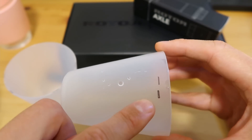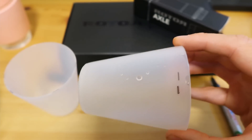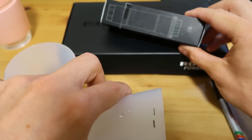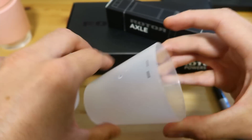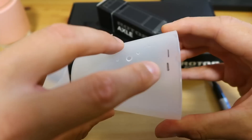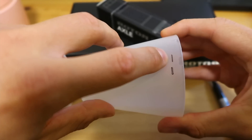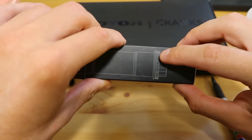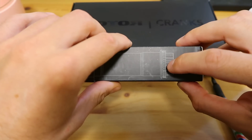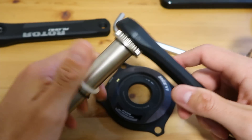You can clearly see the slightly bigger male taper didn't go in as far as the slightly smaller male taper. The tolerance of that diameter has to be so well controlled, especially with these tapered splines, because these aren't straight conical tapers you can turn accurately on a lathe — this has to be CNC'd with quite a complex cutter. The tolerance of that diameter and that profile has to be perfect, otherwise you get huge discrepancy. I measure about two and a half, nearly three millimetres of final axial position difference. If you had that on your spline, you either wouldn't compress your chain ring spider — so it would be wobbling around — or if the male taper was too small you'd compress the chain ring spider nicely, but you wouldn't get a good mate on the rest of the taper, and the crank would wobble.